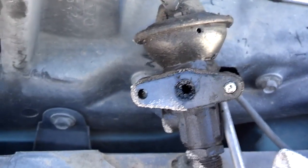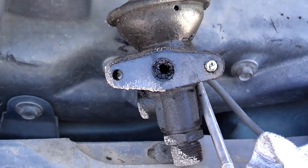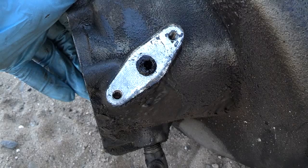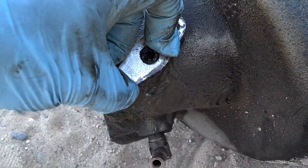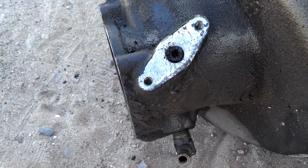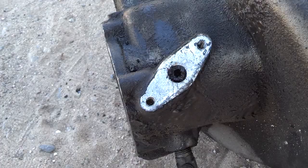If you look at that EGR port, it's like half of it is plugged up on this side, and then when I come down to the manifold, it's about the same on the manifold — about half. Now, on my car this stuff was hard. This is hard too. It's breaking away, so you want to get a screwdriver or something to break that stuff out of there. It's just buildup that's not supposed to be in there.